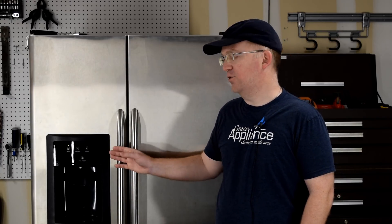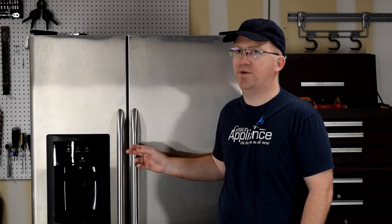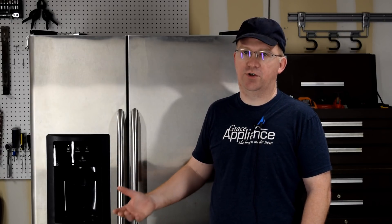This video we're going to talk about what to check if your refrigerator is too warm. Now typically this is going to be one of two scenarios. It could be that your freezer section is doing just fine, running right around zero degrees Fahrenheit, keeping everything frozen rock solid, but the refrigerator section is too warm. Or second scenario, it could be that both cabinets are running on the warm side — either they're hot, or just running warmer than normal. Either way, these diagnostic steps will help.